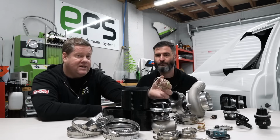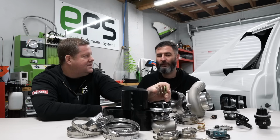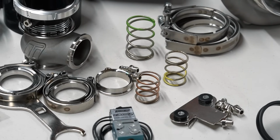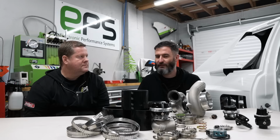And these little springs aren't cheap. I don't know if you've ever tried to buy some spare and separate, are they? They're not your average spring from somewhere, are they? They're not. They're designed to spec, and they're only designed for the wastegate it's with. It's not like we've just gone to a supplier and said, we need a spring this tall. That's spec'd for that 45 mil gate, based on the engine back pressure that we theoretically included, to say that that is a 7 psi spring, that's a 5 psi, that's a 3 psi, and there's a 14 installed. The spring that's there is designed for that.